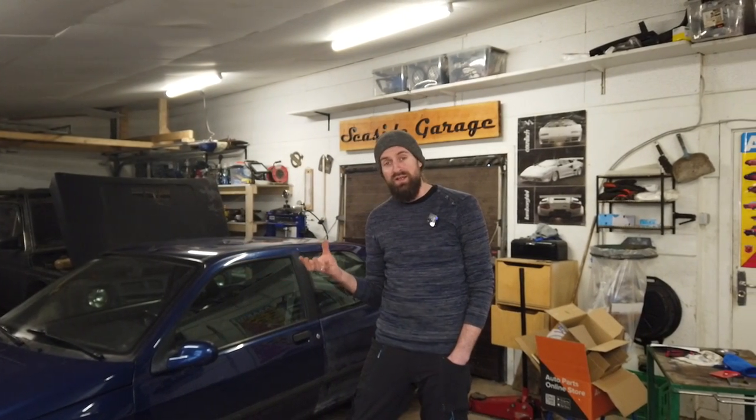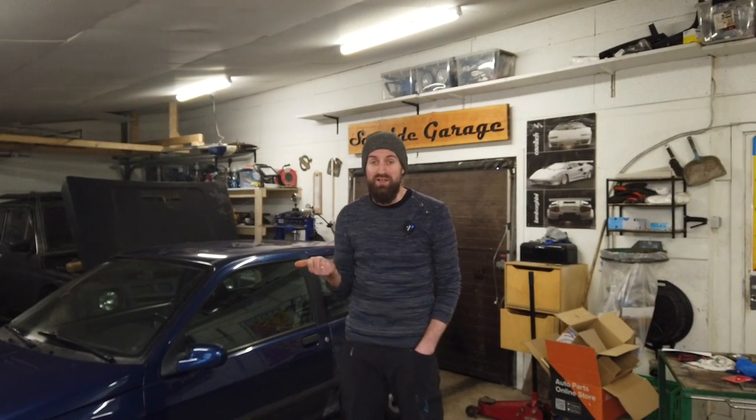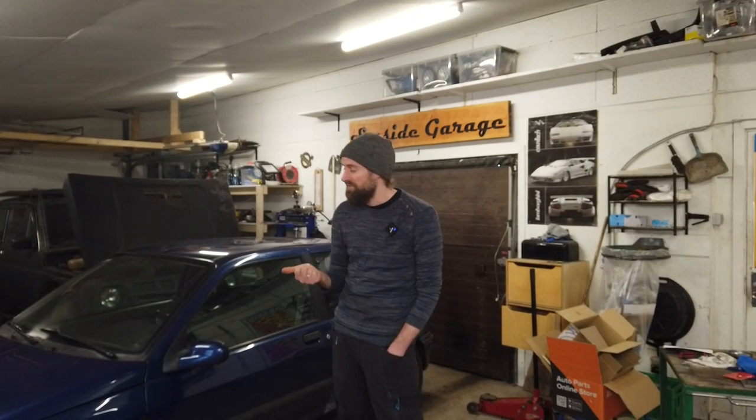It's already hot. I'm going to let it run for 20 minutes with the oil cleaner in the oil, then drain the oil, change the filter, and then it should be better. The issue is that sometimes that will loosen up some crud in the engine that is actually keeping the engine tight, so sometimes you could end up with an engine that suddenly begins to use oil after that.